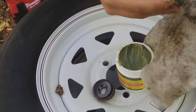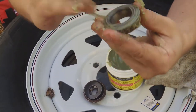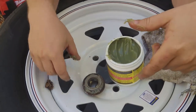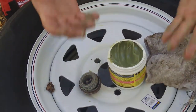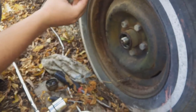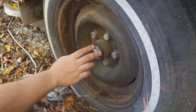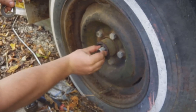Now that we've done that, we're just going to wipe off the excess grease in the interior there, smooth off the edges, and that's done. Any excess grease on the outside is going to be inside the cap, which is good — we want that grease on the outside and on the inside. Okay, so we're going to wipe off the excess grease off the threads here, then we're going to put the bearing back in — you put it in this way, not this way, this way — so it goes back in. Just going to push it in as far as she'll go.